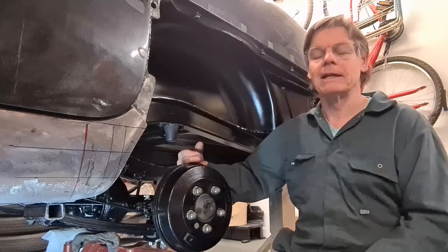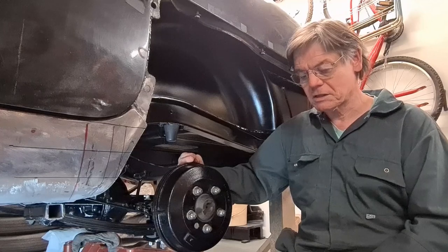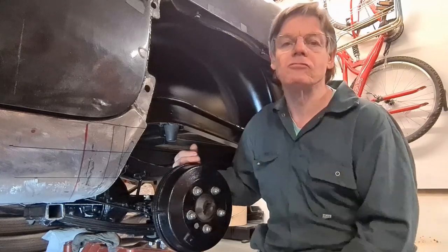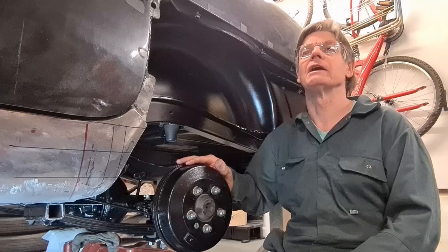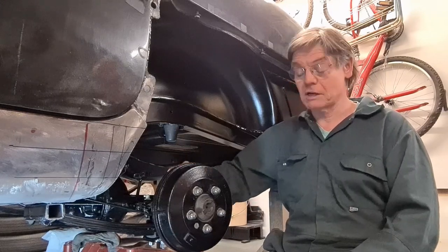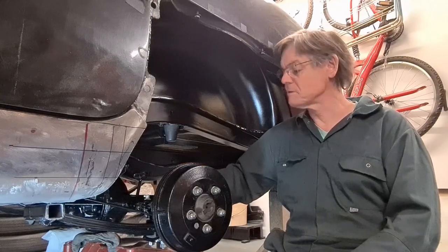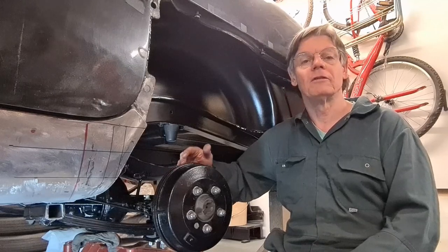I've been reading the book about these adjustable stops on the back plate. It looks like this is a later modification because this is a late model car. The book says they were fitted to all Consuls and Zephyr Sixes from engine number 210021 and 161561, and they mention brake judder — so it seems they had problems with brake judder and the shoe wasn't laying correctly. They tell you to drill and tap the back plate, weld a nut on the back, put the pin in with a longer pin, and lock it with another nut — so it could easily be retrofitted to earlier cars.